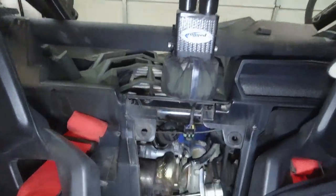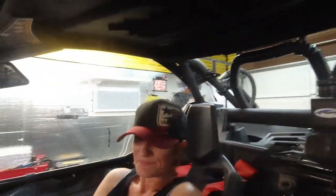We are gonna take the stuff off and go back to the 3RI so that we can run the car for some 0-60s. Good news is I already did. I put the OEM actuator back on already. But we do have the big injectors from Evo, OEM actuator, full exhaust from Evo. We're on the 3RI tune with 91 octane because that's what we have available. Did you change the fuse? I did not. We need a 30 amp fuse, but that's going to happen. We also adjusted the crack pressure to 8 PSI, which it was already at. As soon as we get some fuel, tomorrow or Monday, we will make some jumps and do some more tunes.